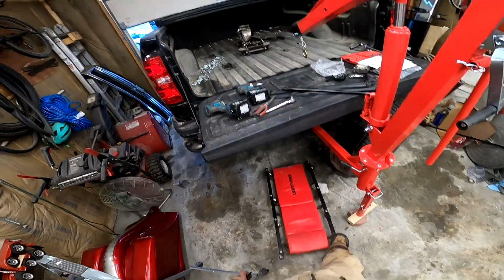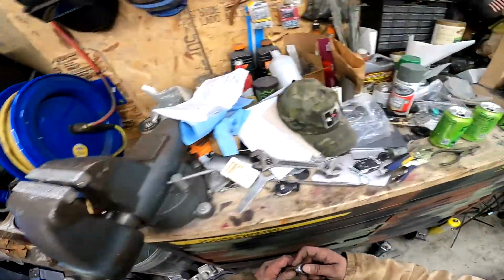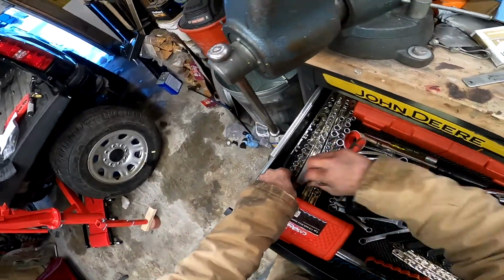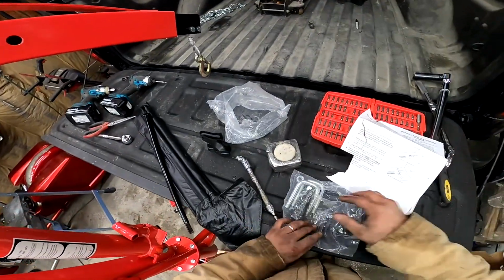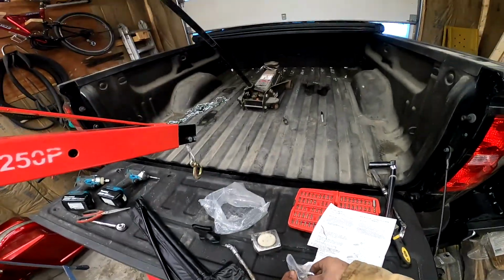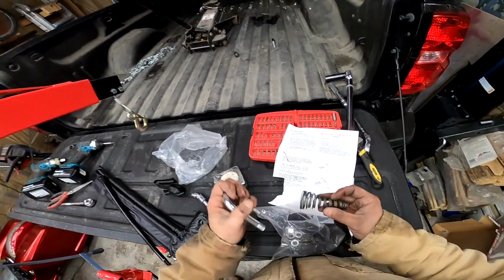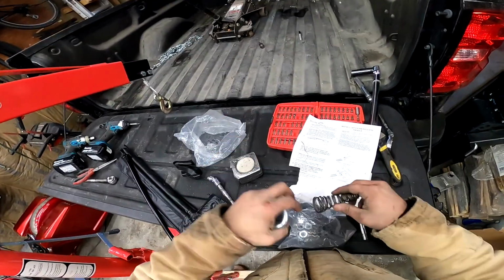Finger that nut until we get it close enough to tighten up with this little ratchet. All right, so now we got that all bolted in. As I said before, the only pieces I'm not putting in today, because I'm so over this, are these, which are U-bolts, because I'd have to back drill the holes, drop these in, and then put a spring on each one, followed by a nut so they pull flat down.